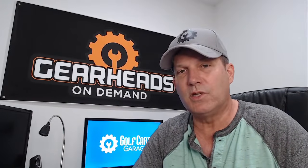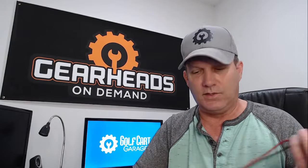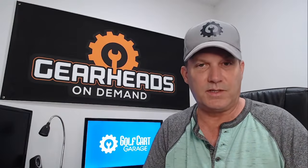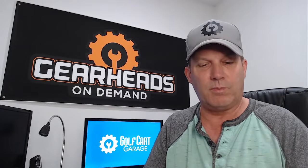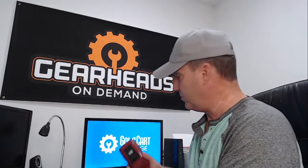So do them individually. Like what you do is, I may have said this before, get some alligator clip leads for your voltmeter. They got little clips on the end, so you can clip them to your battery, and then you can bring your voltmeter up in the seat with you, and then you can watch your voltage as you hit that hill, and you can do that 6 times if you got 6 batteries. You can do that test 4 times if you got 4 batteries. Go to each one of your batteries and watch for one. What you're looking for is one that's dropping out way worse than the others.